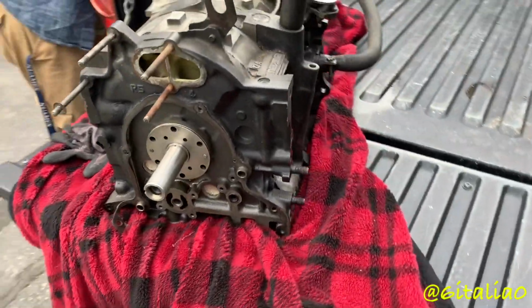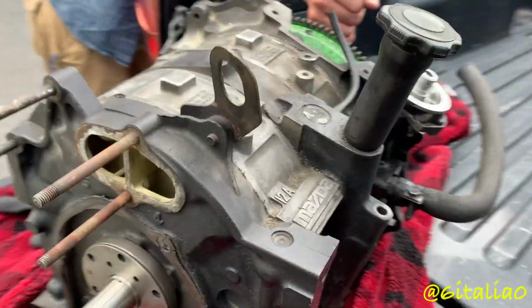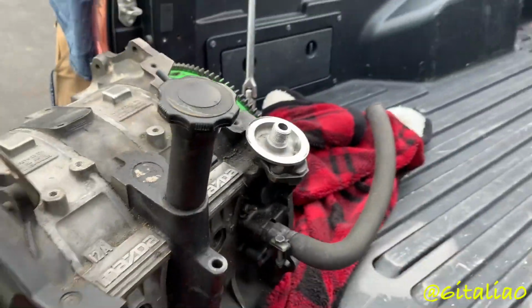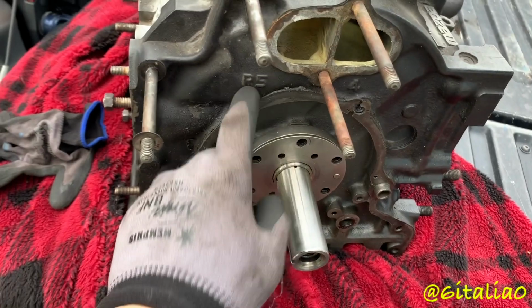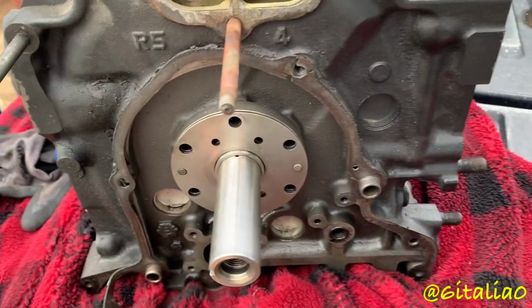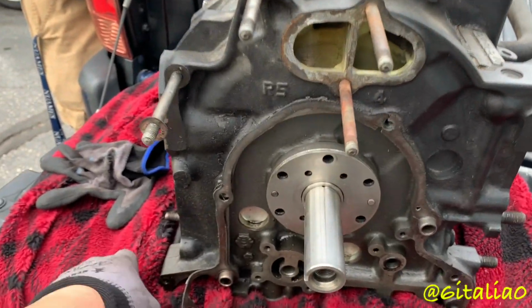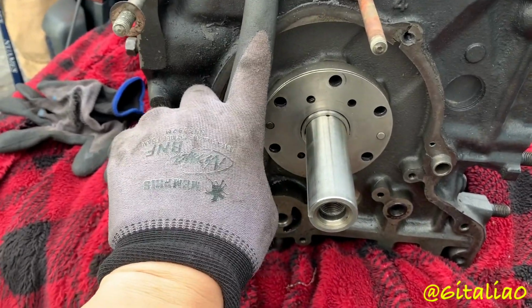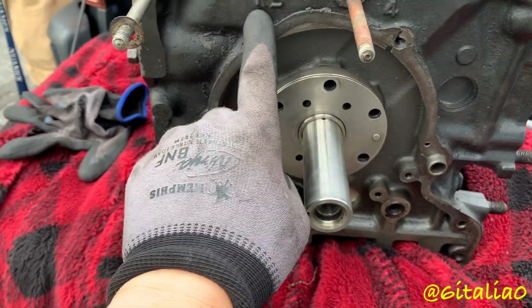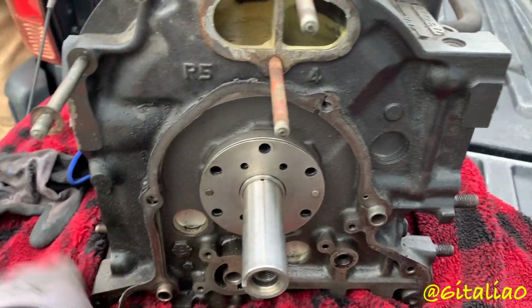And one thing that I think is really cool about this particular 12A is that it has all R5 cast irons. Now, for those of you who don't really know what the significance of R5 plates are, which is something I've gone over with the Killer B before, is that they are nitrided. And for old school plates, that's pretty significant because there's only 3 types of old school plates that are nitrided. That is R, without the 5, and all R plates aren't exactly nitrided, but most of them are. So R, R5, and Y cast.